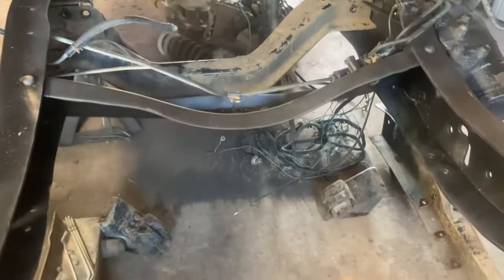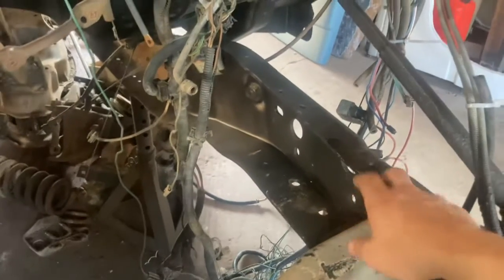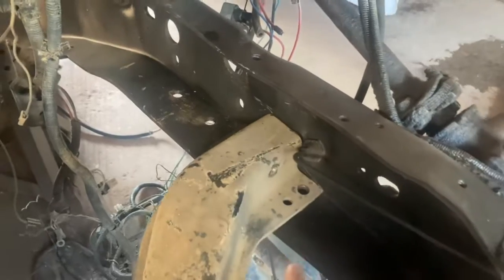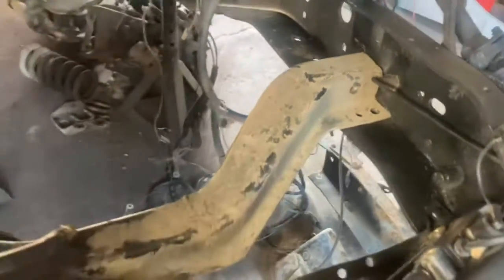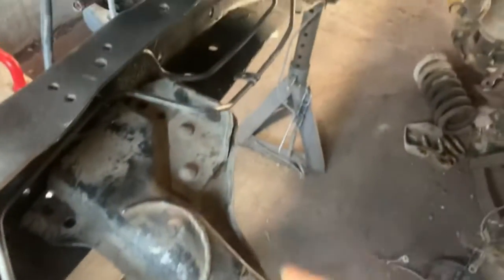I've got all the crossmember and motor mounts removed off of the old frame rails, and now I've got the crossmember sitting in here. But I've come across a problem. Even though this is, I believe, a one-ton frame and that's a three-quarter ton frame, because this is two-wheel drive it's actually half an inch shorter here for the motor mounts. And of course I've got all the two-wheel drive brake lines in the way — the four-wheel drive normally comes down on a bracket. I've got to change the four-wheel drive brakes anyways. Fuel line and rear brakes are a little different, so I've got to figure that out and figure out the height difference.